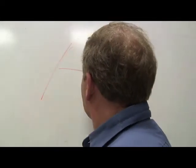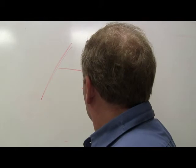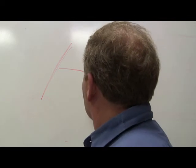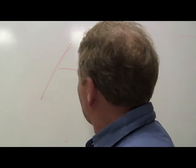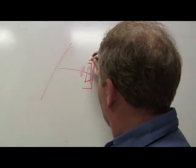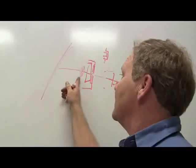The needle would be out here, and it would sit in that hole if you blew that up. It would sit in that hole like that. Now that was right here. What would happen is there is a little spiral spring hooked to this that would hold it back toward zero. Mounted on this speedometer needle was a magnet. As that drum would spin faster and faster, that magnet would try to follow it, but it was having to work against that spiral spring.